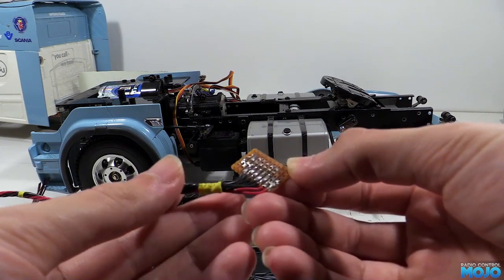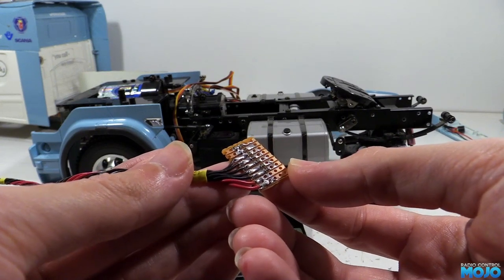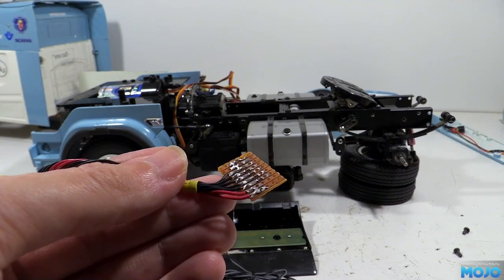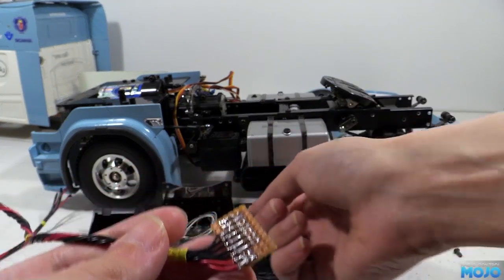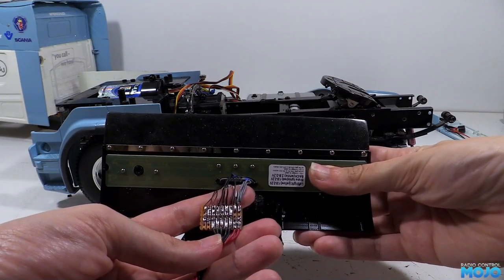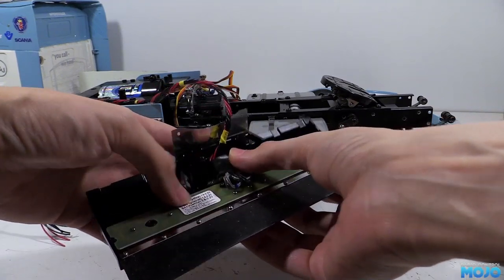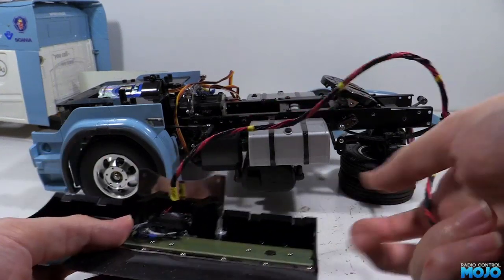The red wires carry 5 volts and are connected together — at a later date they could be split for separate supplies. The black wires carry the grounds for the left and right indicators, the number plate light, reverse, the brake lights, and have suitable surface mount resistors on the board. To connect it all we need to do is connect the anode wires to the red wires on the board and connect the cathodes to the black wires but the other side of the resistors. The board will now get wrapped in some insulation and carefully stuffed out of the way. I'm going to use some hot glue too, just to make sure it can't move around and fatigue the end of the wires.